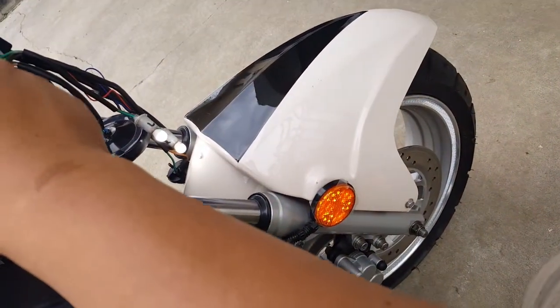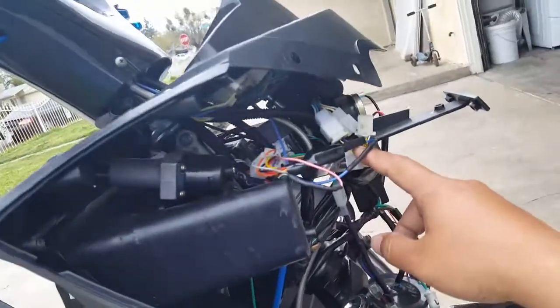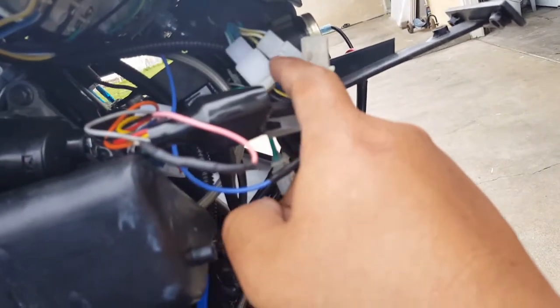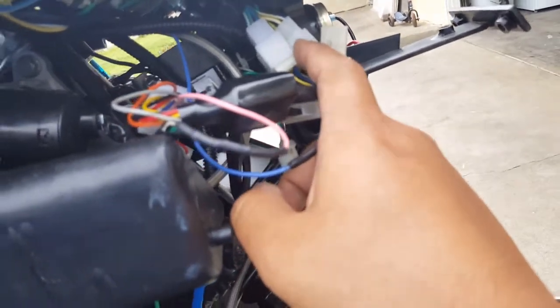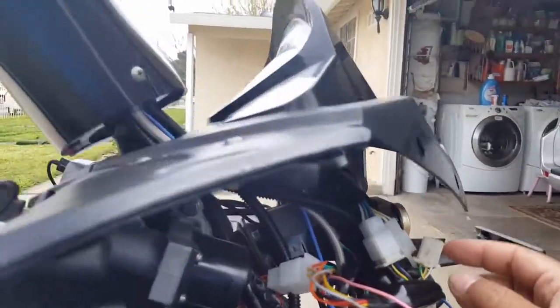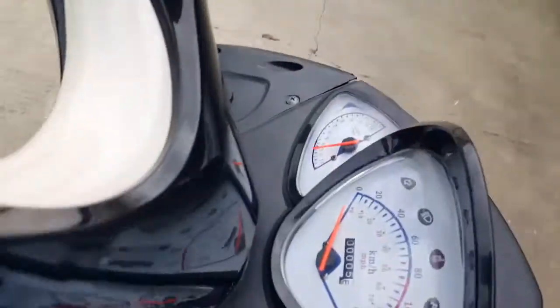I don't think this wire harness is bad, because if you look at it, I don't see any lights flickering. It's only flickering when I pull it down enough to move this other wire on top here. This is probably the most sensitive wire here. There's a short wire here somewhere. I can't tell which one it is yet. All right, so, oh, our RPM is working now.